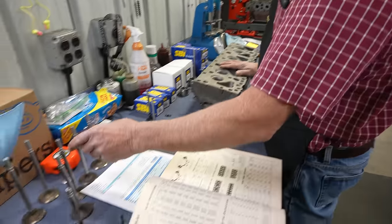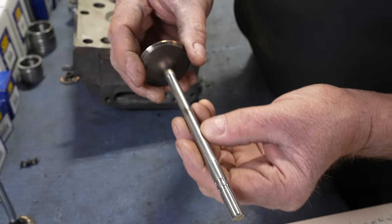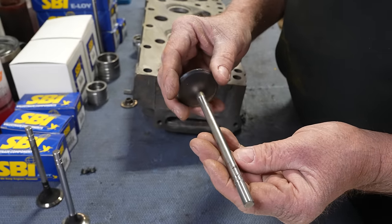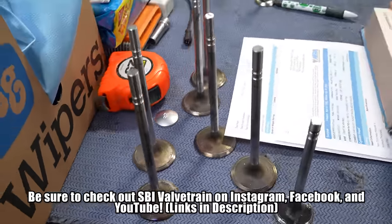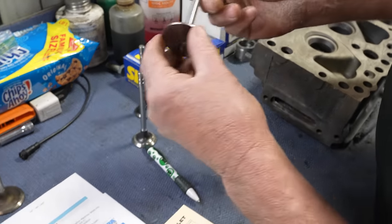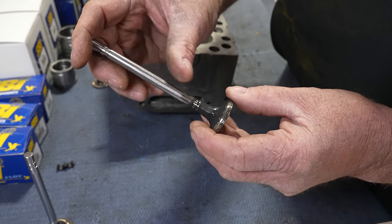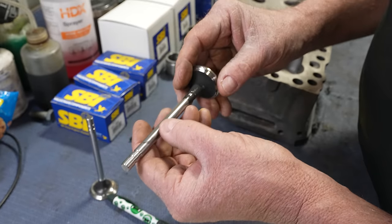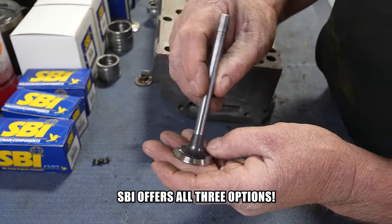When we tore this down it did have all brand new SBI valves, but evidently whoever built this engine thought it was a good idea to put a pretty excessive crosshatch on the brand new valve stems. I don't know what their whole idea was — some people think it holds oil and makes them lube better — but obviously it didn't help on this engine. SBI has sponsored us with all brand new parts to go back in again. We are not going to do anything to those valve stems. We've opted to upgrade to the next generation valve with the chrome-plated stem, and also a heavy-duty stellite-faced exhaust valve — the heaviest-duty valve we can get for one of these engines.